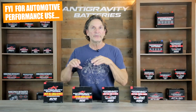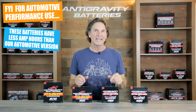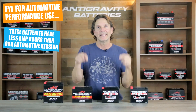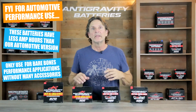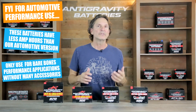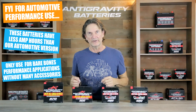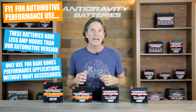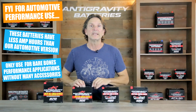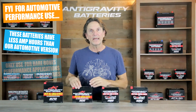As a note to the performance car enthusiast who may want to use the ATX20HD or ATX30HD in their car: these batteries are lower on amp-hours than our dedicated automotive-sized batteries. If you're going to use them in your street performance vehicle, make sure you do not have many extra accessories, larger stereos, or items that would draw a lot of energy. These batteries are intended for bare-bones performance cars, not regular passenger cars. We like to see a minimum of 30 to 40 amp-hours used in passenger performance cars. If you are aware of the limitations, they can work in your application, but they may require charging more often.